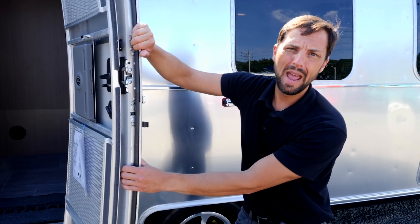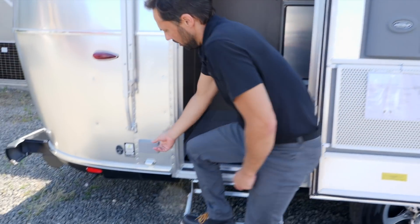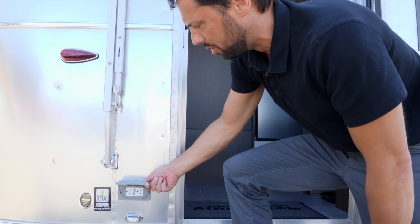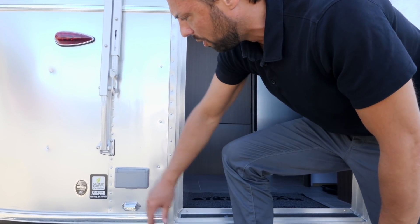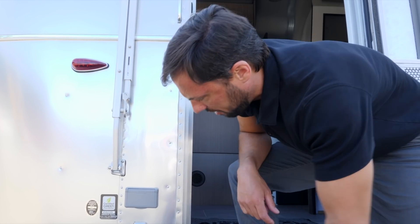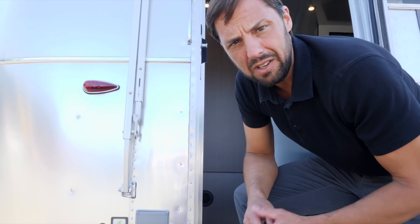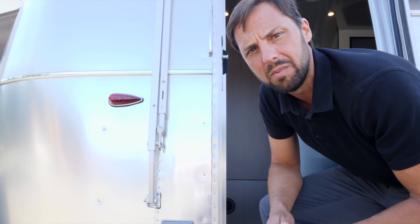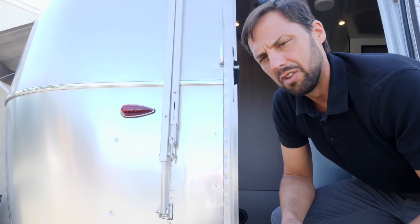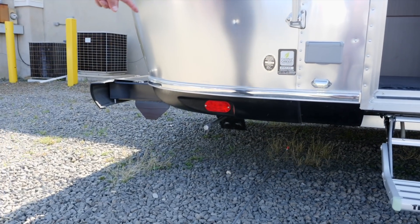To the left of the door there's an outside GFCI-protected electrical outlet — only works when plugged into shore power or a generator. There's an LED step light by the entry door. Below the trailer is all wrapped in aluminum belly pan with small gaps for airflow so the underbelly can breathe. All Airstream traditional travel trailers have heated tanks in the enclosed underbelly — as long as the forced-air propane furnace is on, it boosts the temperature inside the tanks. For cold-weather camping below freezing, the furnace gives about a 7-degree boost to the tank. There are heavy-duty stabilizer jacks at all four corners.